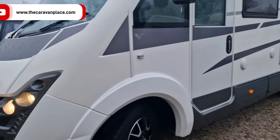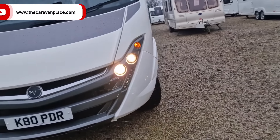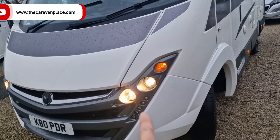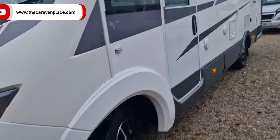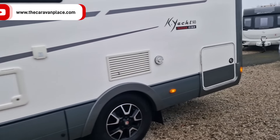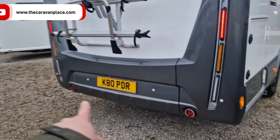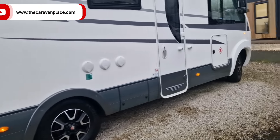Literally just putting all of our lights on, making sure all the lights are working. We might have a set of lights here - sometimes they may come on and off as we turn, so double check those. On this one we've got a set of lights off at the front, but all the side indicators are working. We can check our brake lights and reversing lights too. Everything looks good except for those two at the front. We need to put our fog lights on as well. After spinning the steering wheel, these little lights are now not working - that may or may not be an MOT failure.